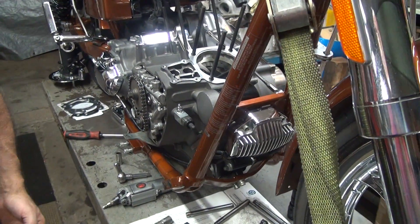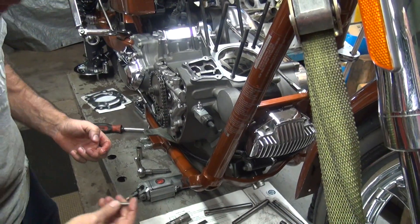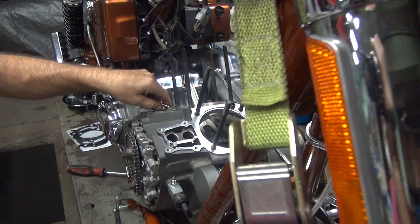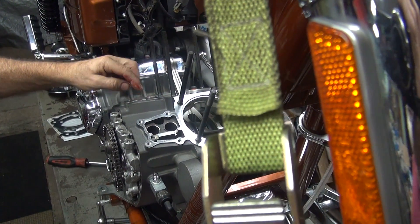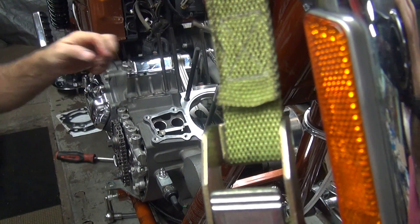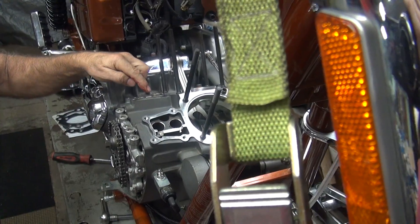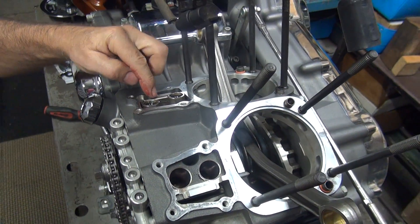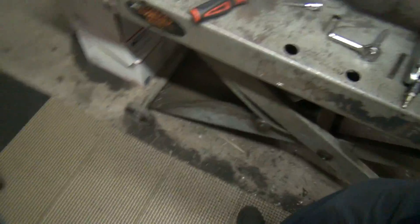Big magnets work too. I got some fancy tools — the screaming eagle tool that does it. So there's your pin. That's called lifter retention — anti-rotation. When the pin is in there, they don't rotate. I see — that locks that flat spot into place. Now in your race car, you've got these things called link plates. Guess how many of those link plates break versus that pin? I bent two of my plates. Well, try bending that pin.